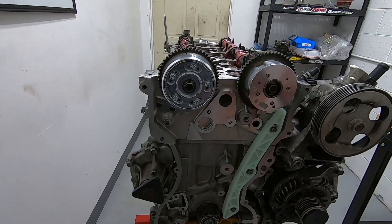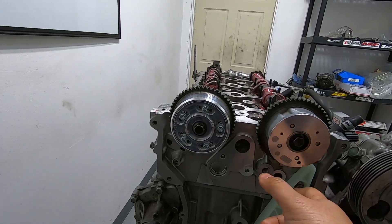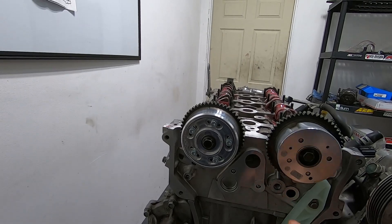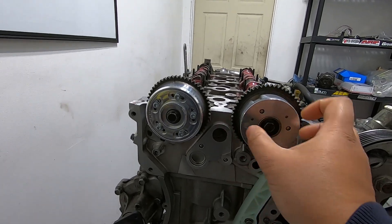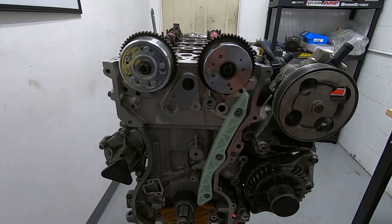The scavenging creates low pressure in the combustion chamber, helping the high-pressure intake charge air move in faster and allowing more of it to enter. Also, because the intake valve opened early, it's also going to close early — so when it compresses on the next stroke, it can compress the charge more because the valve stays closed longer, which produces a lot of torque on the low end.